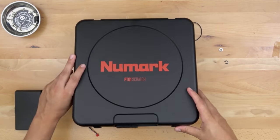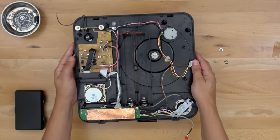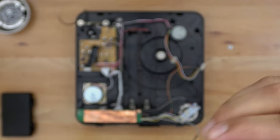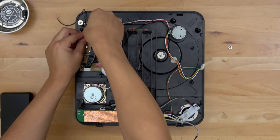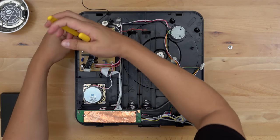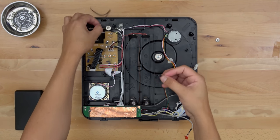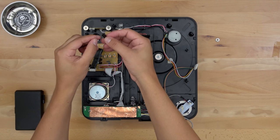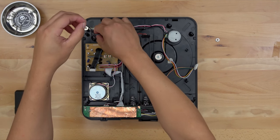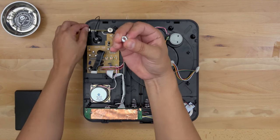Slide the tonearm into place and lock it down. I always put the top back on when I need to flip it over — even if I don't latch it — mainly so I don't mess up any of the components on the top side. Now that we have it flipped over, let's snap on Jesse's e-clip using needle nose pliers. Then we need to put the switch lever back on — feed the cables through it first, and then screw it right back on. Let's add the new nut and tighten that up.